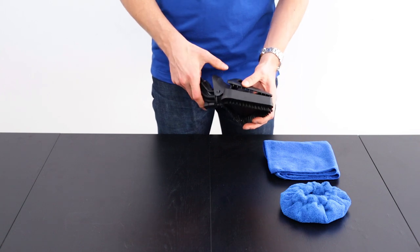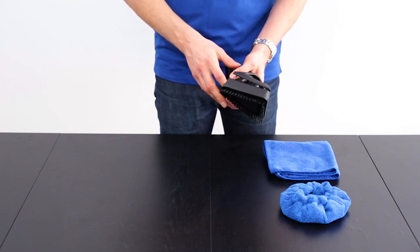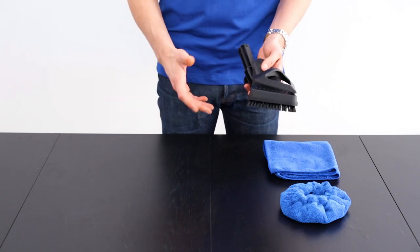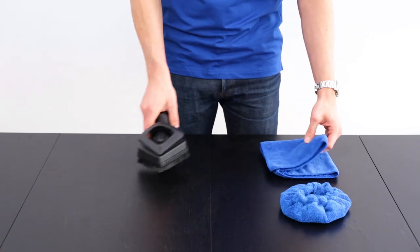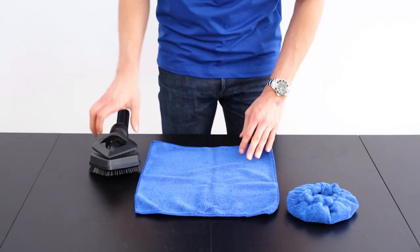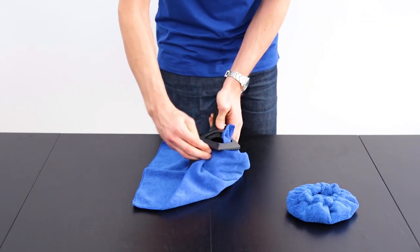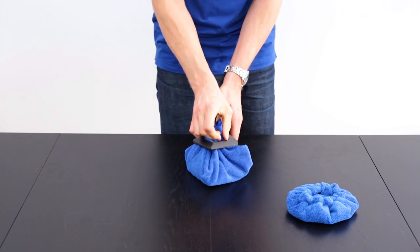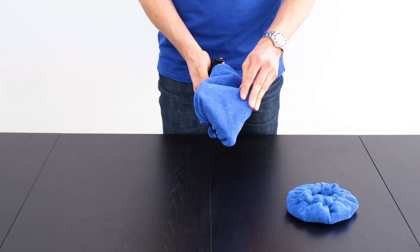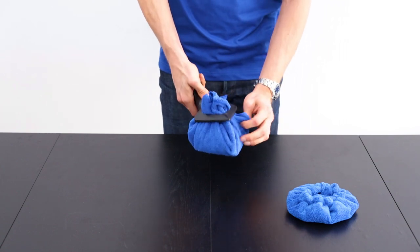The first tool to go through is the triangle tool — one of the most important tools. You can use it to clean fabric and upholstered seats, disinfect countertops, kill bedbugs, and for pretty much any type of larger surface but not flooring. To use it, we typically use it with either a microfiber cloth or a bonnet. To install the microfiber cloth, open it up, place the tool in the center, open the clip and pass it under. The cloth collects the dirt, collects the humidity, and also insulates the steam so that it's hotter. To remove it, push the clip and pull it apart.